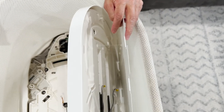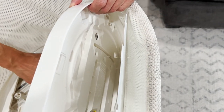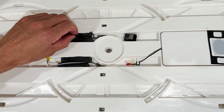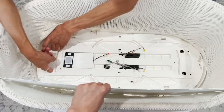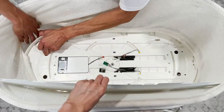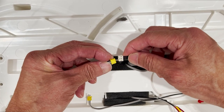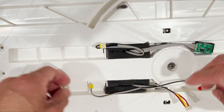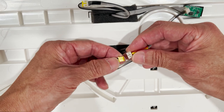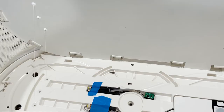When we pull on the two tail ends of the floss, that brown piece will be aligned with those three holes and we can screw everything together. Then we're going to pull those wires back through where they came from and reconnect them. Make sure those brown pieces are somewhat on their track — they don't have to be aligned with the three holes but they do have to be on that track so this middle panel will realign. Reconnect the wires — one, two. Be careful because they're pretty fragile; we had to do some soldering the first time.